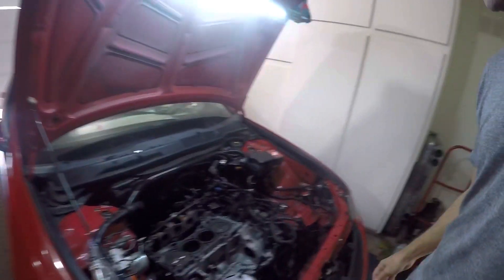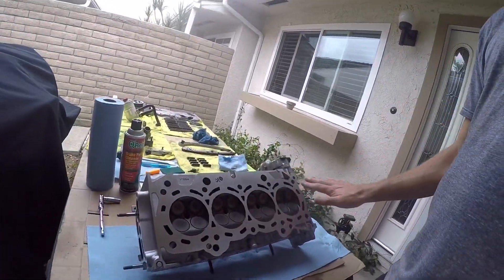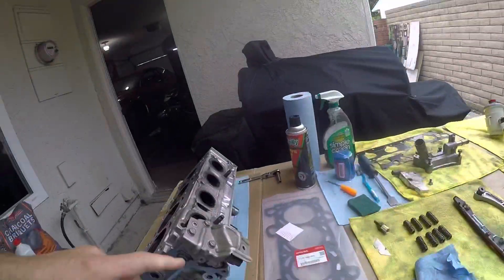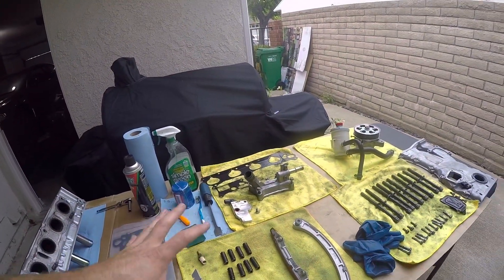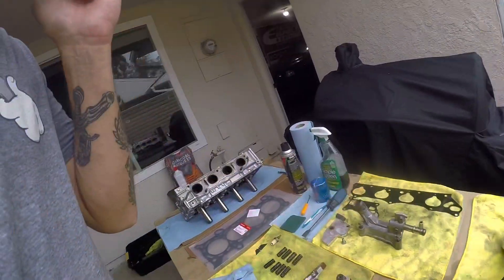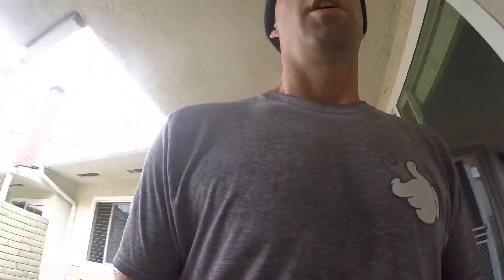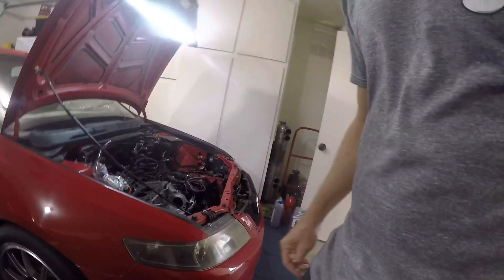Alright, we're back. The head is still off the car, but we have the head back from the machine shop — my friend Jaren was kind enough to take it down and pick it up. It's freshly resurfaced. Just getting the prep work done here — installing the VTEC solenoid back on, got a new head gasket, new oil filter, cleaning up all the parts. Going to put the water neck back on and then it should be ready to bolt the head back on. The car is on the ground now and I did get the new inner and outer tie rods in.